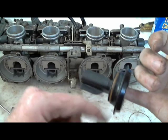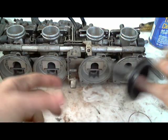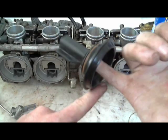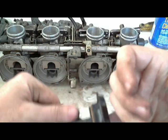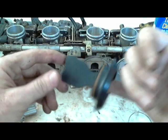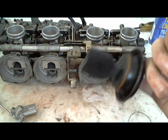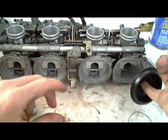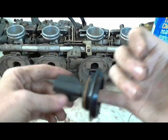If you replace one because you mess it up, you're going to be better off replacing all of them because they're all going to have the same wear on them, with the exception of one that's going to be brand new. So they're all going to be creased like this, except for one. And that difference in that one cylinder would put a little bit of a hamper on performance, and you would notice a difference. So the bike would probably shake a little bit at idle or higher RPMs, just because of the differences in power produced by each cylinder, and how one cylinder is producing more power than the other three are individually, because it's operating more efficiently, more smoothly.